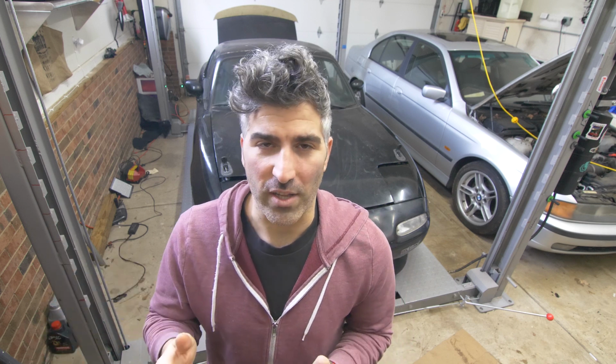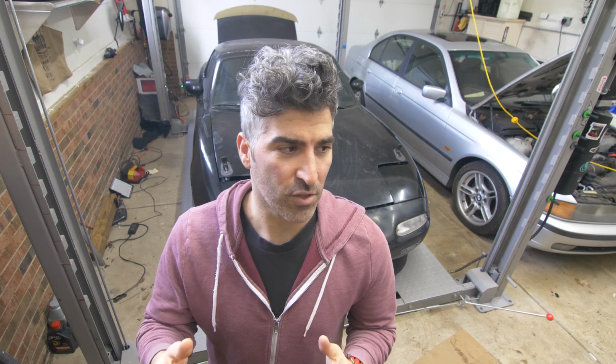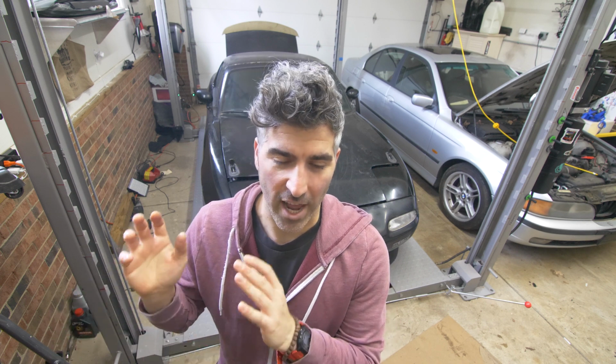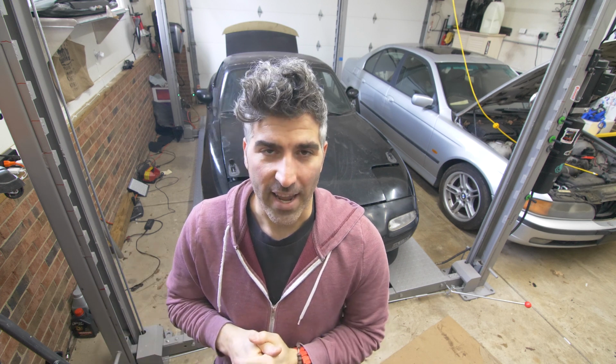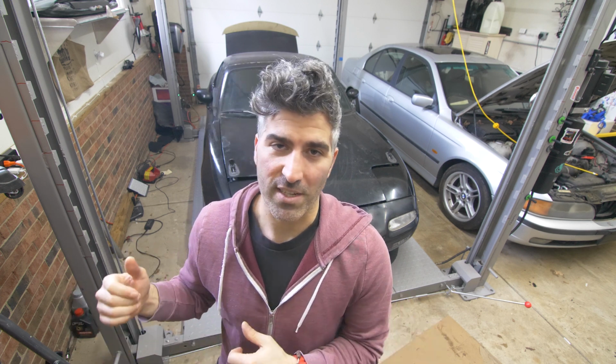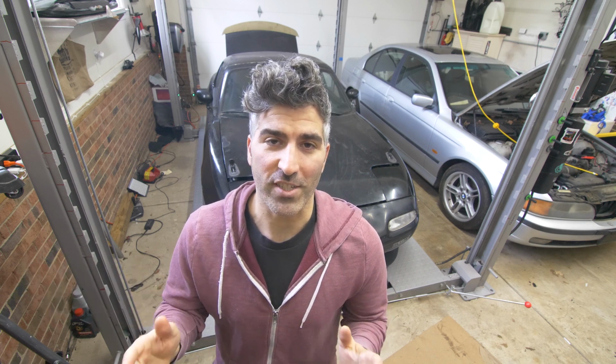So on long left turns or sweeping turns, that type of thing, sometimes the car would hesitate and struggle. And if you got too low of a fuel level, it would actually stall. So originally I thought it was the fuel sock and then the fuel pump and all of that. But after opening up the fuel tank, what we saw was the baffles inside had actually completely rusted through. So we knew that we needed a new fuel tank. And unfortunately with that comes removing the subframe and all of those components, so kind of just sad. But yeah, we're here today.